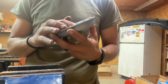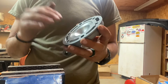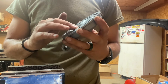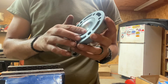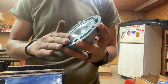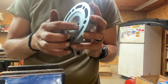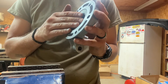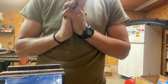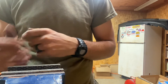What I'm probably going to end up doing is have them take out all that damage, take down that scallop, take out the damage, and mill that at a 10-degree squish angle. And then whatever they take out of there, I'm going to have them take off the deck to give me a one-millimeter squish from the edge. That will translate to one millimeter all the way through the squish because the piston is domed as well. So share that little cool trick — hopefully it can help you out sometime. Check you out later.